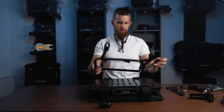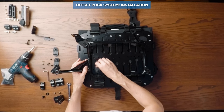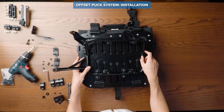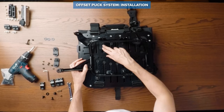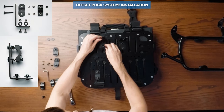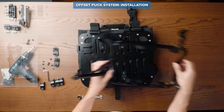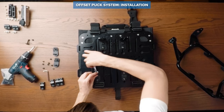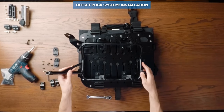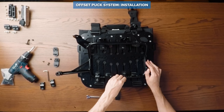In case you have an offset rack like this one, you'll have to use the two supplied offset brackets. Start by checking the alignment and then install the two bottom pucks like before. Assemble your offset brackets like shown on the picture and slide them into the correct slots. Make sure you use the shorter screws for this. Fine-tune the position of the bottom pucks and secure them to the back plate. To fine-tune the position of the offset brackets, first fit the rack and secure it with the two C-shaped clamps to the bottom pucks.